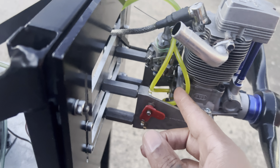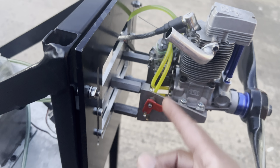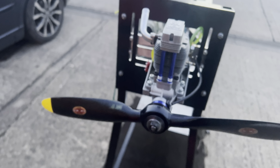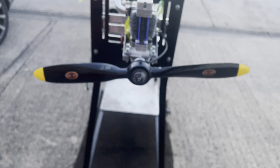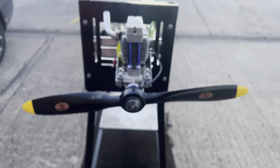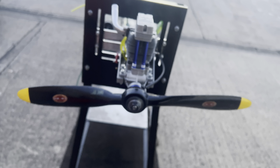So we have serviced the carb, checked the valve gaps, and changed all the crankcase pressure lines back to the intake block itself, all brand new. We gave the engine a good clean out on the inside and set it up on the bench. The prop is a 2-blade BLA 19x10. Idling happy between 1100 and 1200 on this prop, top RPM 6100 we see at the moment.